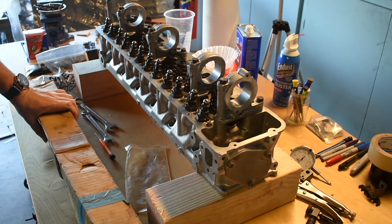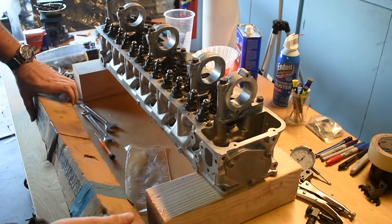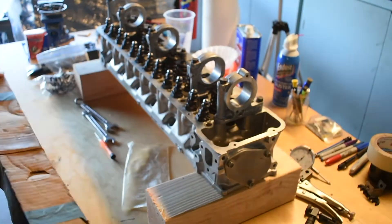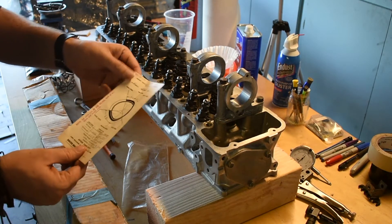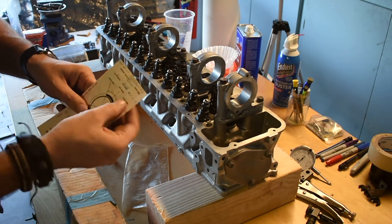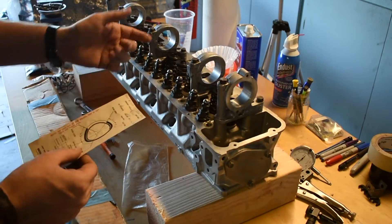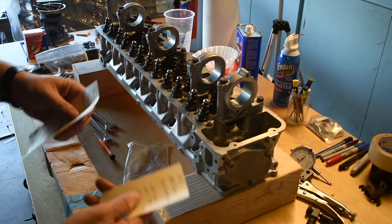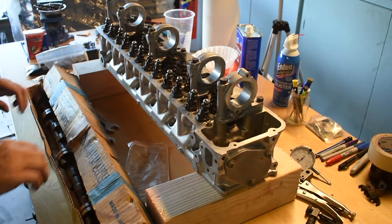I haven't mentioned the camshaft I have. It's a Nissan Original Motorsports part — a genuine Nissan Racer Brown camshaft made for Nissan Motorsports. This is the original cam card. It was made on 10-26-82. It's supposed to have 0.325 valve lift, but they had to shave it down to 0.322. So let's start by cleaning it up.